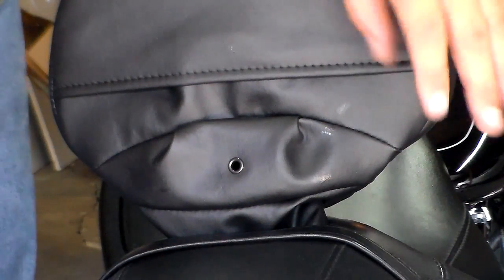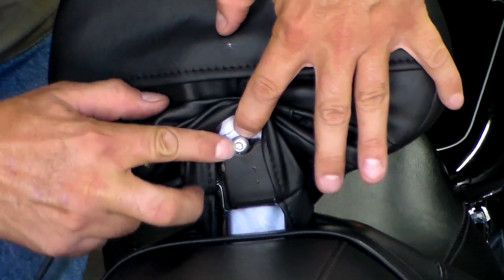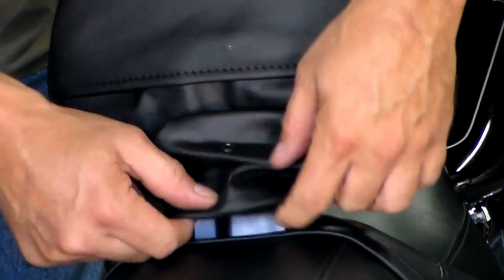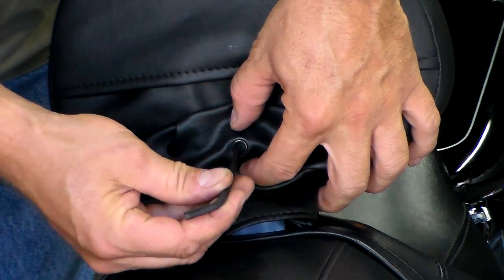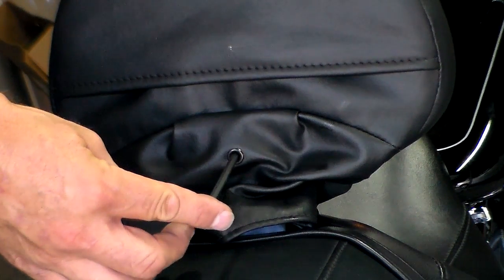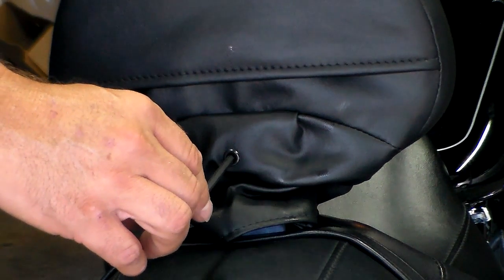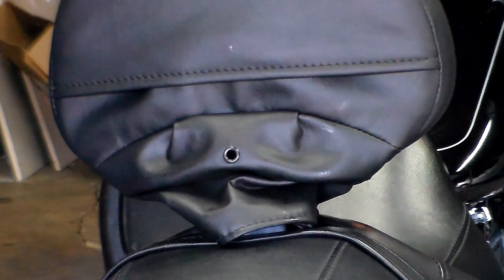The last thing you can do — there's one more adjustment. I'm going to pull the cover off for you. There is an Allen bolt right here — I actually put a little grommet in there. You can take an Allen wrench and put it in there. What this does is it adjusts the tilt of the top of the backrest, to be able to push it into your back or back it off however you need to. That's one more adjustment you can make to the backrest. So that's how you install a backrest on a 2015 Street Glide Special — it should be about the same for most touring bikes. I appreciate you subscribing to my channel. Give me a thumbs up and visit my website at rideatwrenchant.com.